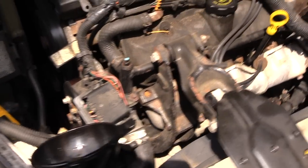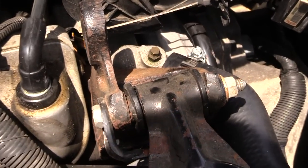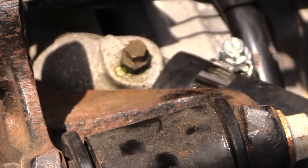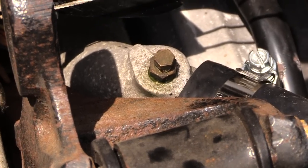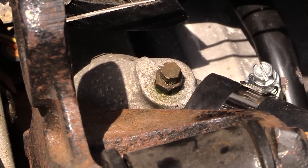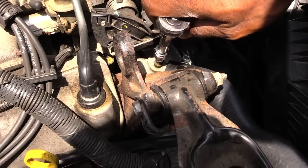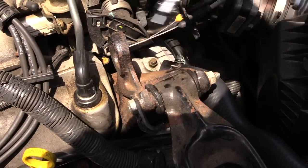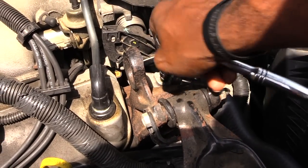You can see on this side the fluid — you'll see fluid starting to come out around the edges. It tells you that the air is out of that system. Once you see that, go ahead and tighten that side back up. Tighten the screw — you might want to do it first with your hand, then tighten it the rest of the way up.